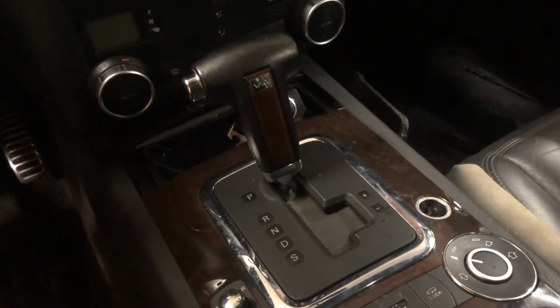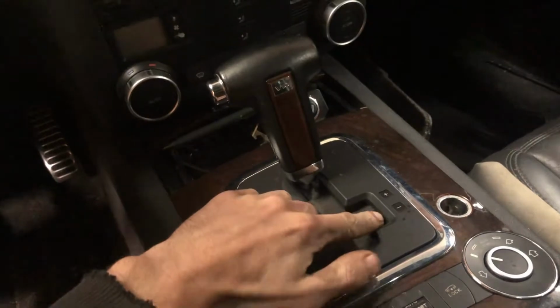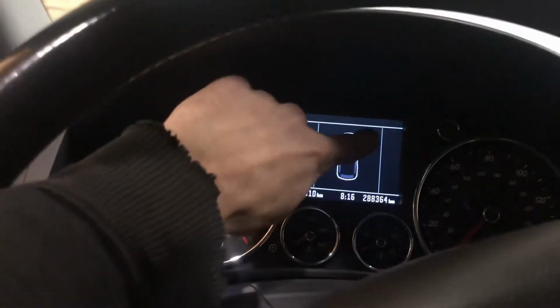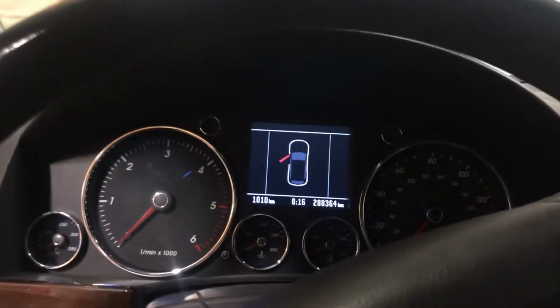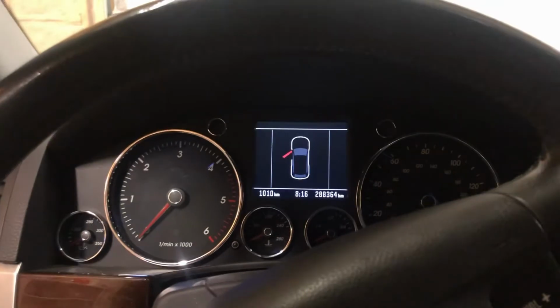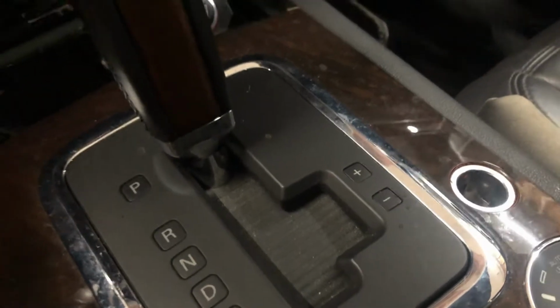So everything's going well. The very last thing, or hopefully the last thing, is the manual shift buttons aren't working. After driving it for a little bit, you have your gear selector on this side here. It'll all get highlighted and everything shifts normally. But if you try to go to your manual up and down shift, it just doesn't do anything.